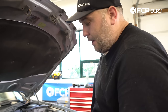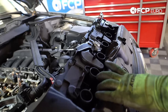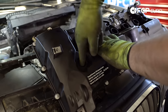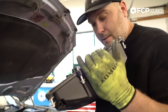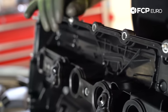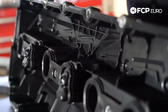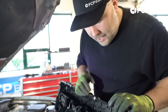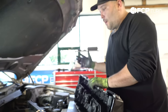Prior to installation of the new valve cover, this has all the new gaskets on it — so your eccentric shaft motor seal, the eccentric shaft sensor seal, and it also has the new valve cover gasket. What I like to do is take just the tiniest bit of silicone and lubricate the inside of this seal so that when it starts to slip over, it'll go freely on its own. You don't have to lubricate anything else — I just do that for good measure. Also before you install, just make sure that all the gasket material is pressed into place and the gasket is fully seated. When we go ahead and put this in position, you don't want this gasket to come unseated and then get pinched when you're installing it. We've got the gasket properly seated, the eccentric shaft sensor seal lubricated, spark plug tube seals are in, all the bolts are in place, and we're ready to slide this in.